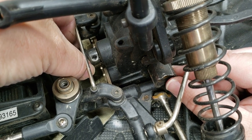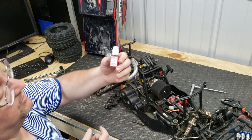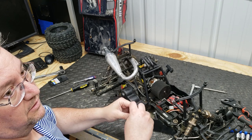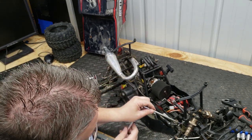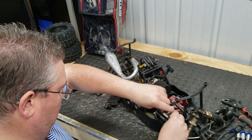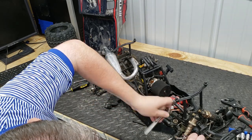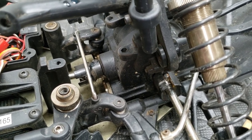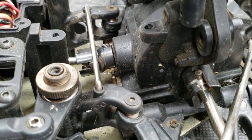Oh, yeah. So I'm going to torque that grub screw back down in there. I'm going to clean the hole out a little bit. So we're gonna go ahead and put this blue Loctite on it. Thread lock, Loctite. Okay, so I got the Loctite on it. Now I'm gonna try to carefully cinch this thing down. Man, if you can look down in there, you can see how much farther it is down into the groove where it wasn't. But that one is much, and it's tight, much better than it was. It's real tight.